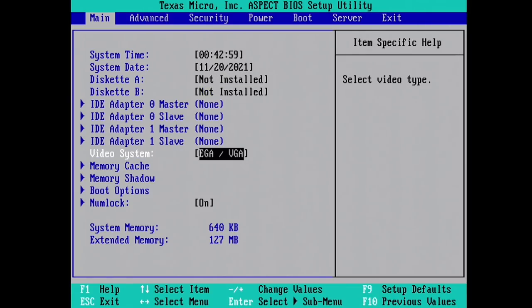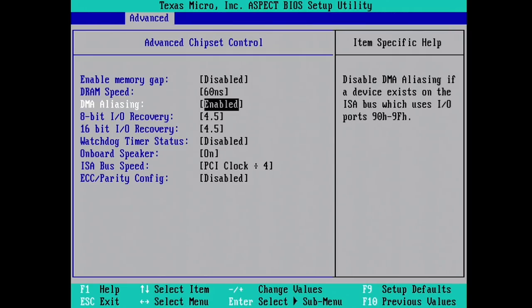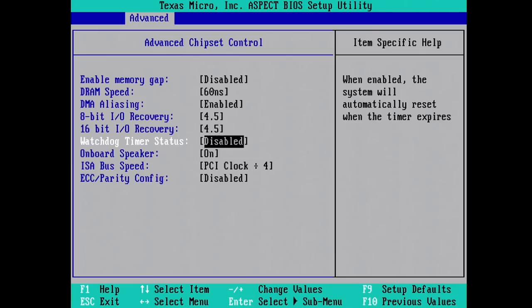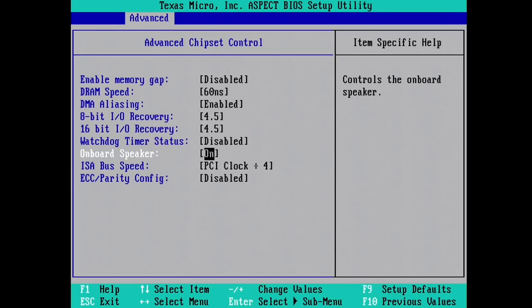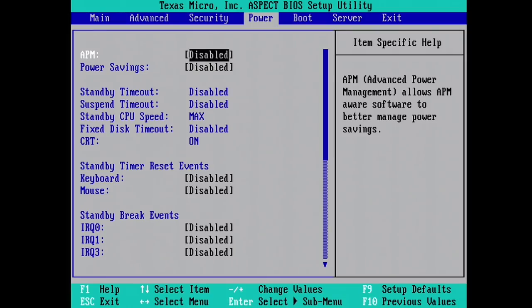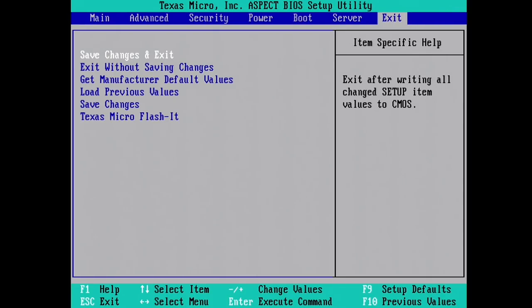The BIOS is just common stuff, nothing special to mention here. Advanced settings, advanced chipset. The only thing we can tweak here is a little bit the DRAM speed. Right now it's set to 60 nanoseconds, but there might be some possibilities to improve the performance of the system a little bit. But for now, I leave it at 60 nanoseconds. We can also change the ISA bus speed here, but I will just leave everything on common settings. Security, power options, some boot options, server options to set something, and that's it so far. Let's boot right now into Windows